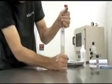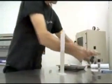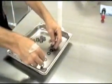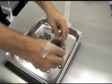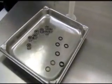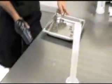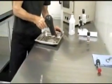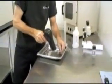So leave it in there for a short period of time, agitate them, put the seals on your table or drying tray, and dry your seals immediately. Make sure your seals are nice and dry like you did with your bearings. We're going to put a coat of oil later on the seals to help revive them. Make sure they're thoroughly dry.